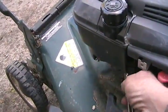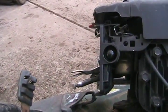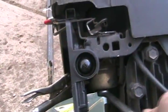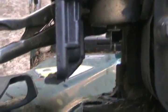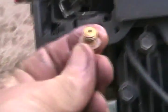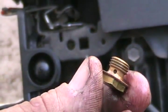Next, pinch off the fuel line. I always assume on an unknown lawnmower that the carburetor could have some water or dirt in it, so I always unscrew the nut on the bottom, dump it out and blow it out, and check the tiny jet is clear. Soon gas will come gushing out, but not the whole tank because the hose is pinched off. Some have a valve to shut them off, like on those older models. That's the little jet — there's a tiny hole in there and a hole that feeds it. It's always a good idea to poke a piece of very thin wire, like from a wire brush, down those holes and then blow them out.